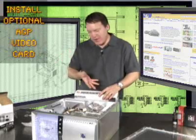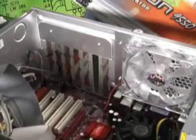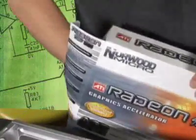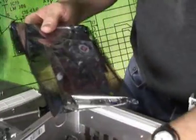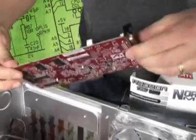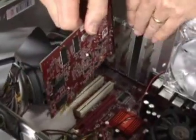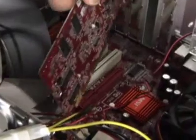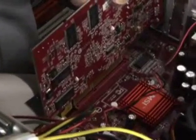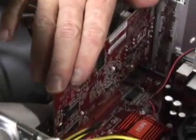With the drives in place, all that's left is the video card, and we have our video card right here. This motherboard has an AGP video slot and we've bought an AGP video card to fit into it. There's only one video slot on a motherboard, so you either look in the manual or just look at the motherboard, find that slot, and line the card up on both ends and push it into place.